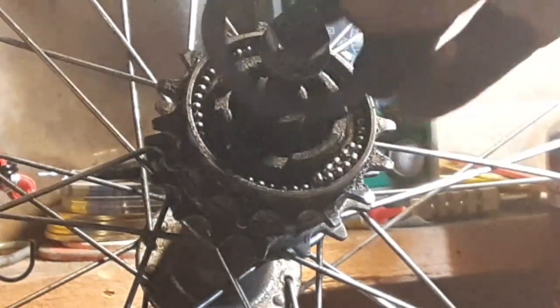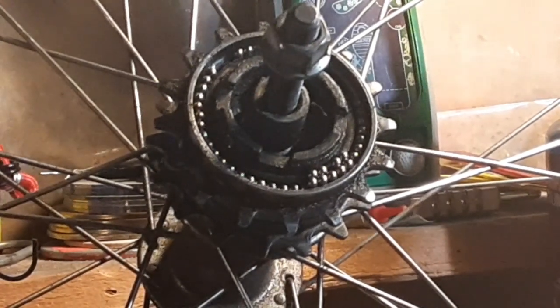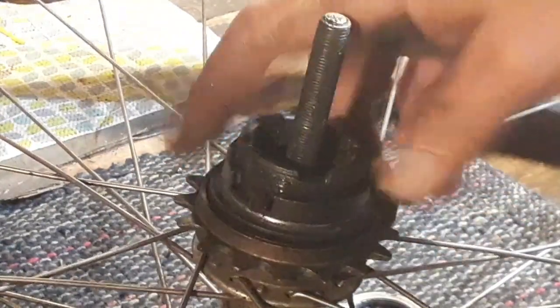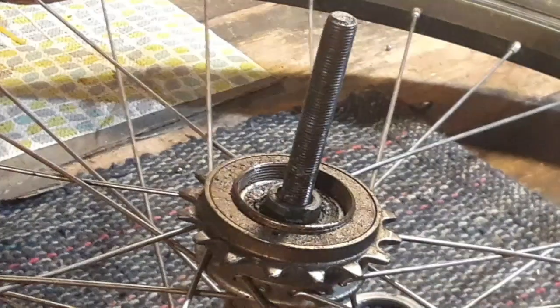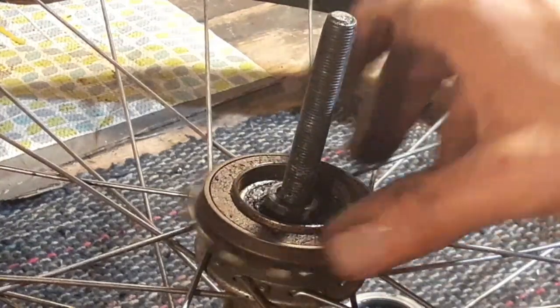After I got the wheel up — that's not supposed to come off; that's the inside of the freewheel assembly. Let's take the bearings out so we don't make too much of a mess, and take a look at the adapter to see if we can get the rest of this apart. As you can see, that's just the whole gear from the freewheel. Taking this apart, it looks like it's gonna unscrew from the other freewheel, but unfortunately that outside piece is the bearing race for the freewheel, and all of that is completely jammed together.